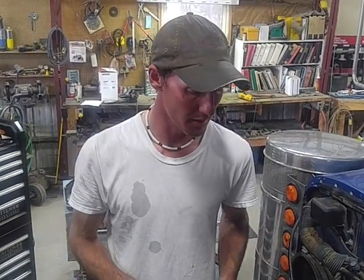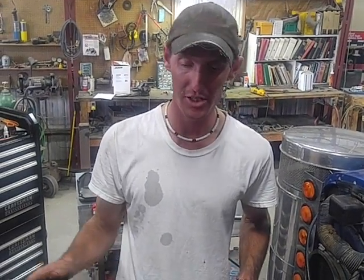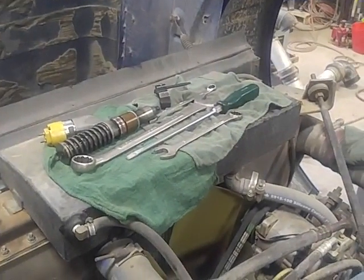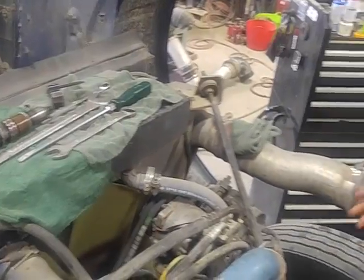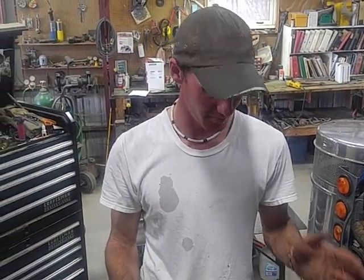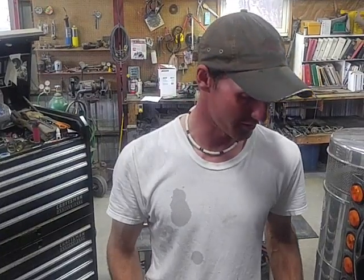And when you're all finished up and you got your overhead run, please guys, pull all your stuff out. Don't forget your injector tool in the motor. Don't forget your feeler gauges. Don't leave your ratchet in the fan. For God's sake, don't leave the bolt in the flywheel. If you go to start it with that bolt in there, your life is gonna blow so bad, you have no idea. So just make sure everything is out of it.